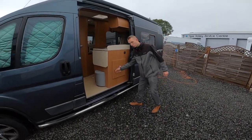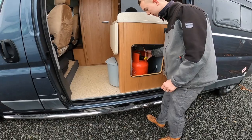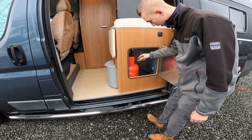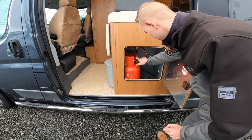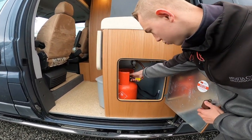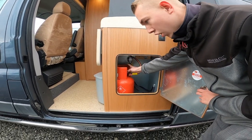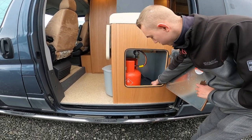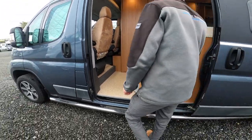Once you've opened this locker door, inside is where you keep your gas bottles. You can fit two six-kilogram bottles in here. It's a left-hand thread and hand-tightened pigtail — there's no need for a spanner. Just hand-tighten the left-hand thread and turn on and off at the top of the bottle. Turn it off when travelling, make sure they're strapped in, and put it on when you arrive on site.